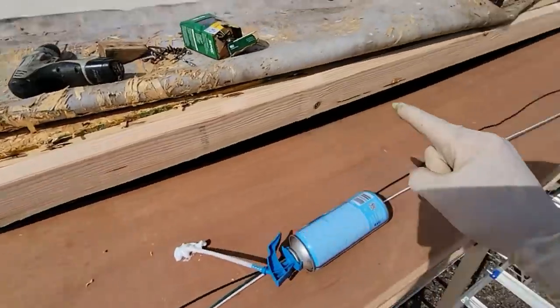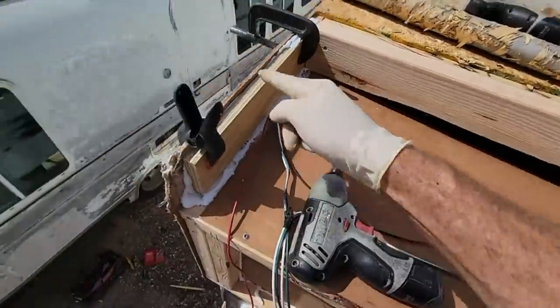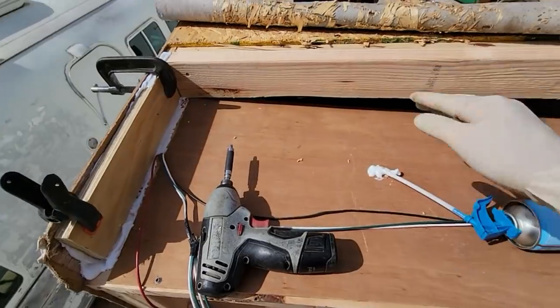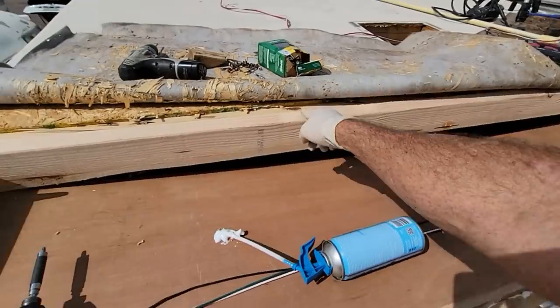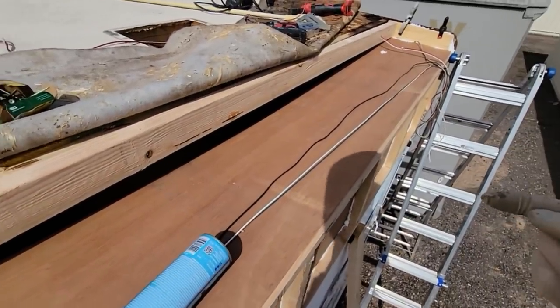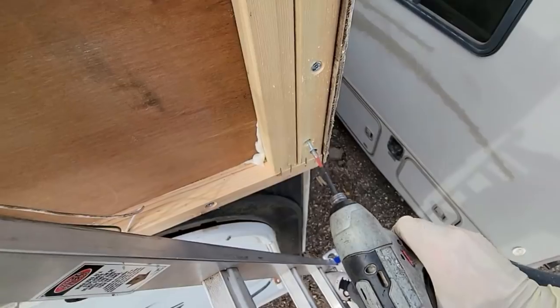All right, so that's the first one that's gonna go in. Of course, the ceiling's temporarily installed, and I did get these 3/4 inch headers put back in. I'll have to make some adjustments as I tighten up this stud into the adjoining joist. But I think we're looking okay. Hopefully we'll have the next one put back once we check back in.